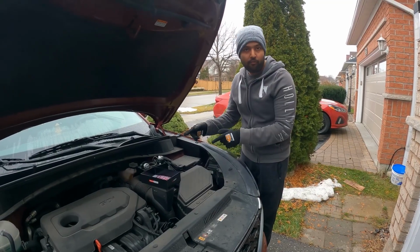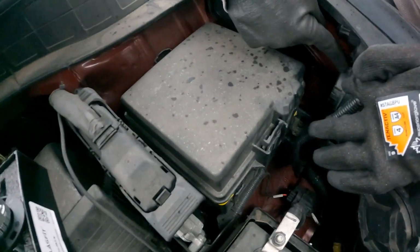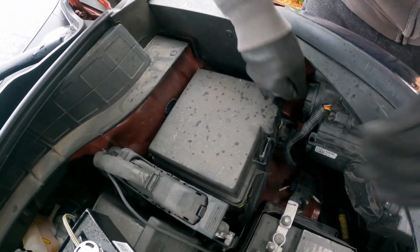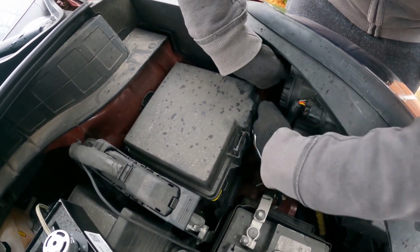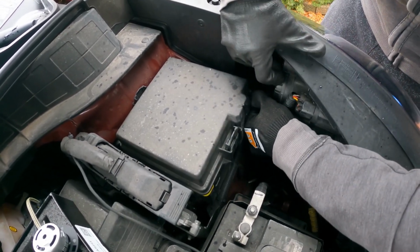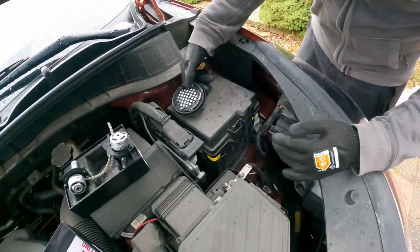These LEDs are for the low beam headlight. To remove the low beam halogen bulb, this is the cover on the low beam halogen bulb we're going to remove. We have to remove this, just turn it anti-clockwise. Use your fingers and hands. It just rotates anti-clockwise. Once it stops, pull it out. And that's it.